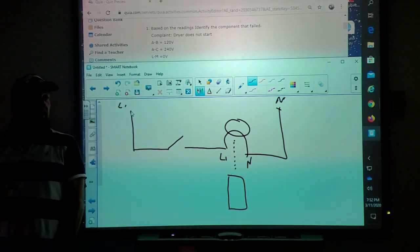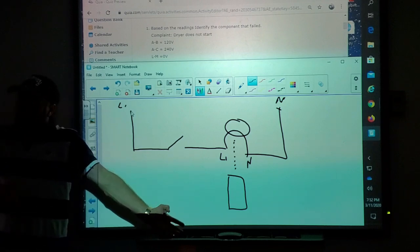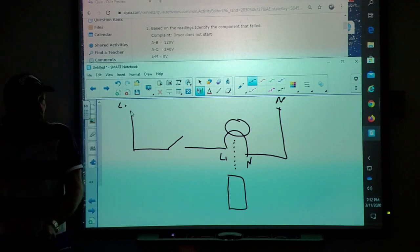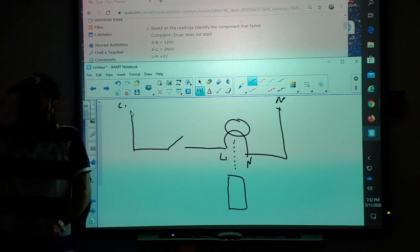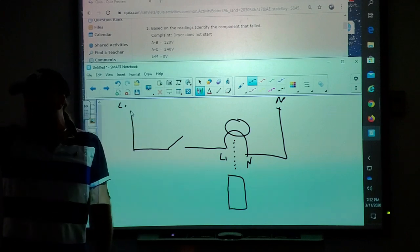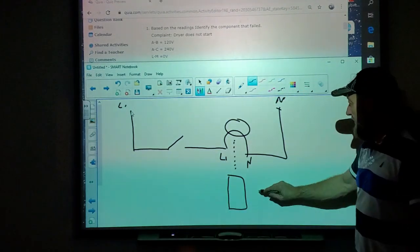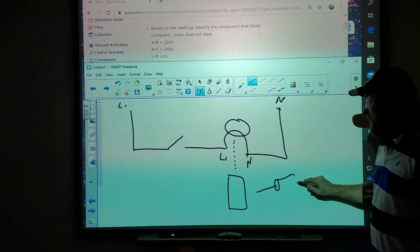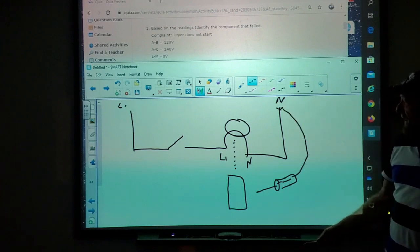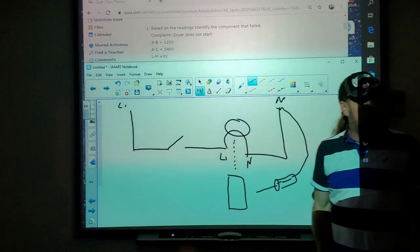Back in the days when they did electrical circuits, most technicians didn't even use an electrical meter to get a value. They just used a test light, like automotive mechanics. They would put one end on ground and they would just touch to see where electricity is. And technically we could do the same thing. If I had a test light, which was just a metal probe, like a screwdriver with a light bulb inside of it, and I connect the other side to the ground, I could just touch here and touch here and touch here until I got electricity.